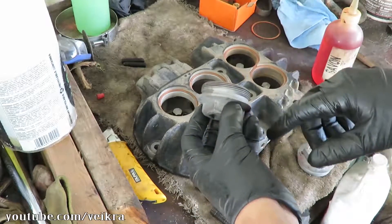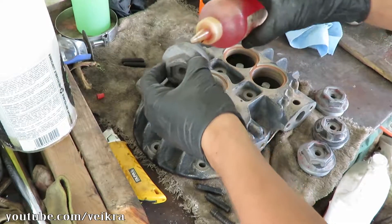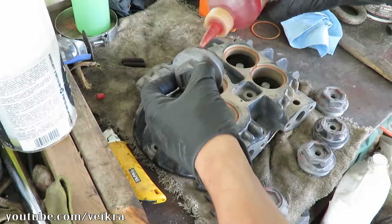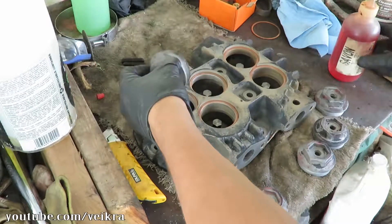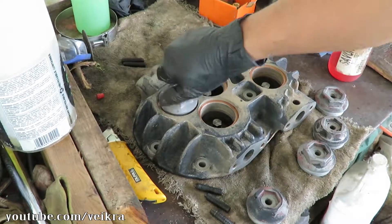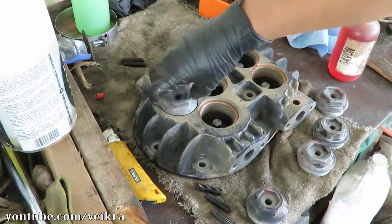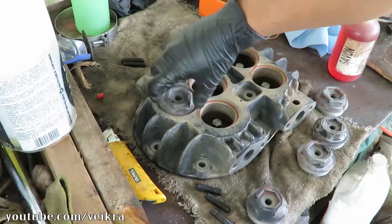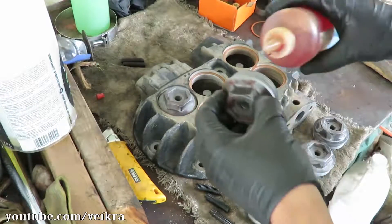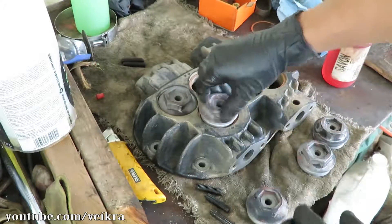You should be putting oil on there before tapping it up — they specify SAE 30, but I'm just going to put a little bit of air tool oil. It just helps when you torque it down — it lowers the amount of torque it takes to spin and gives you a more accurate reading on the torque you're applying. A little bit of oil is all I'm going to need — it's going to do just fine.